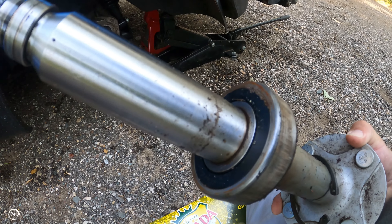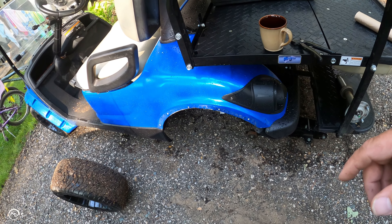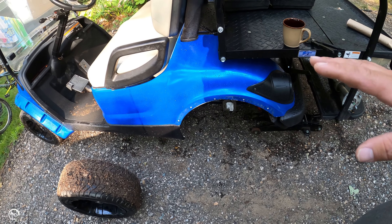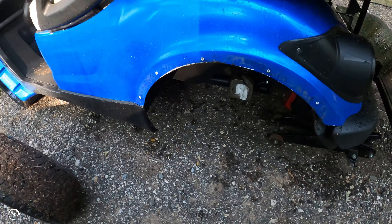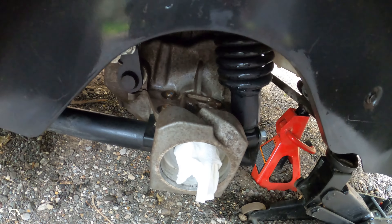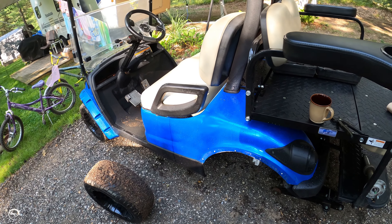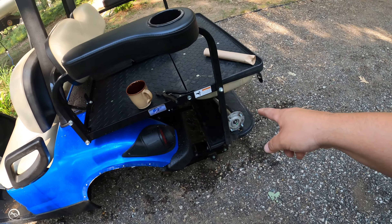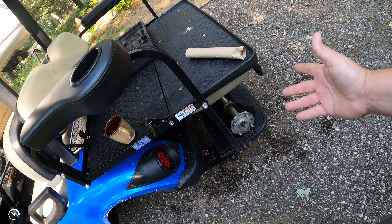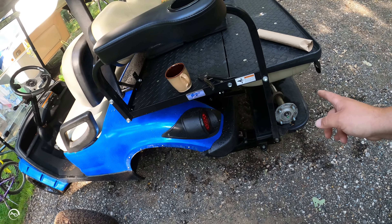The other side is full of stuff, I'm going to have to clean that out. I don't own a press and I won't until Harbor Freight has a really good deal — you can use the 20% coupon. In the meantime, I'm going to bring the axle shaft home because a buddy of mine has a press. I put a paper towel in there just to keep any debris out, and yes — jack stand for safety. I'll get the bearing off the axle shaft at home, put the new one on next weekend, bring it up here, slap it in and be good. I barely tapped it with a three-pound sledge.